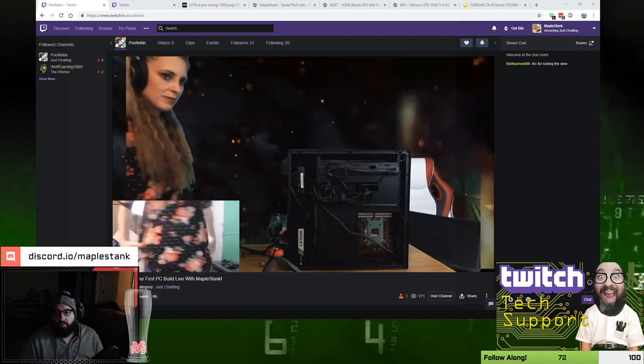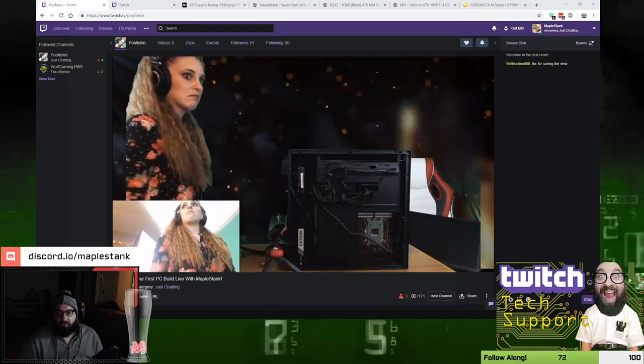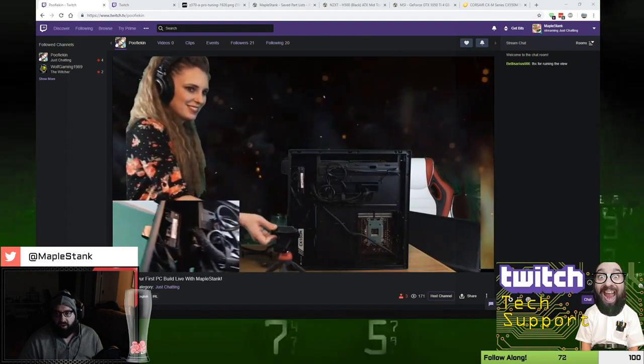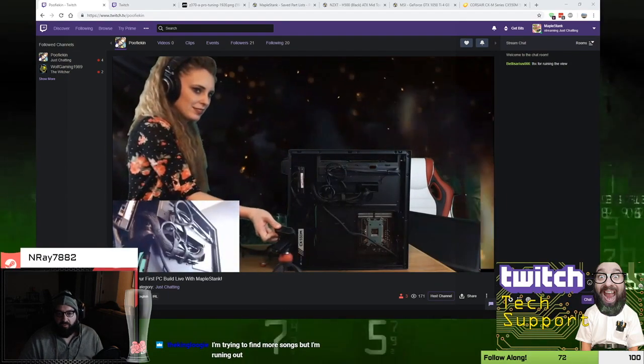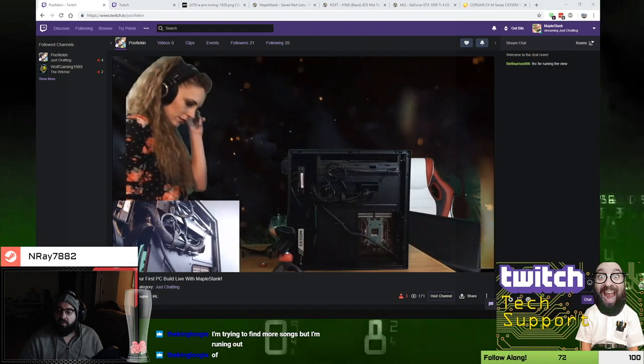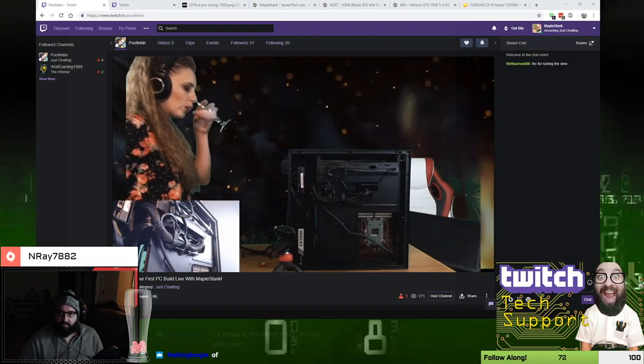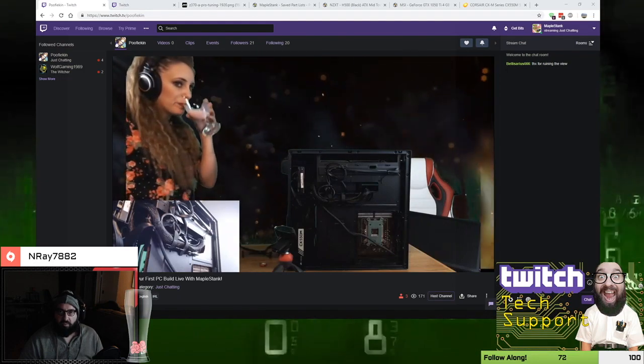You should start going through the wiring and check every connection one by one. And just go to each thing that's connected, the hard drive, and push down on it. The connectors to the motherboard, push down on them. Everything. And you're just going to do that once over on everything. And just make sure that they're all connected. The fan connectors, everything. Okay.